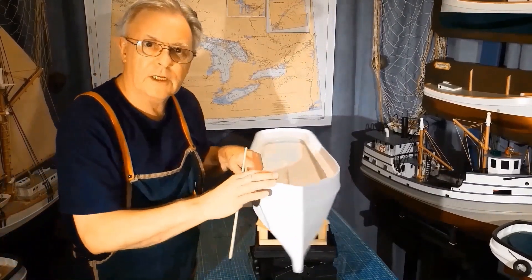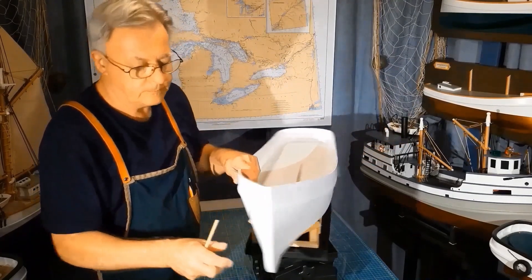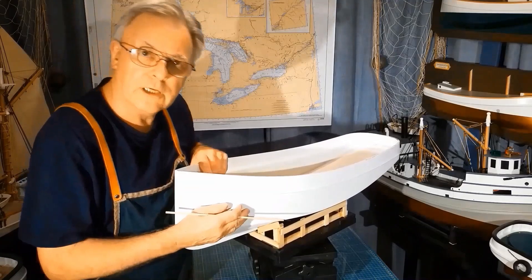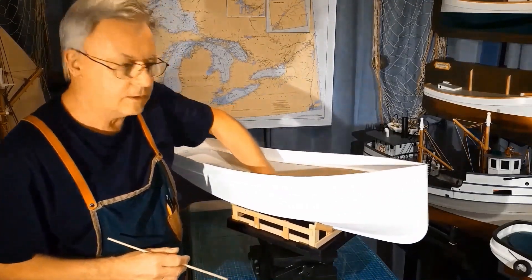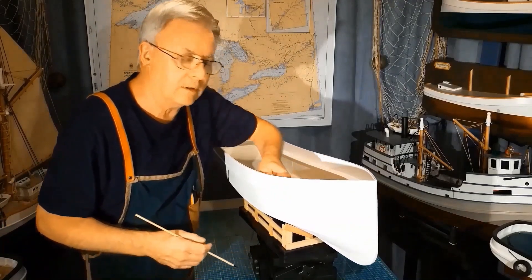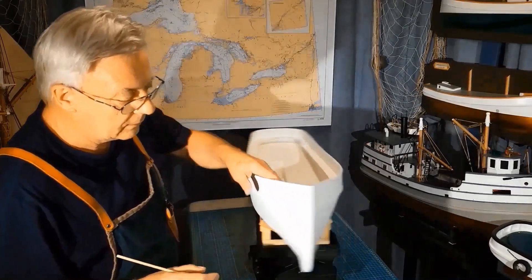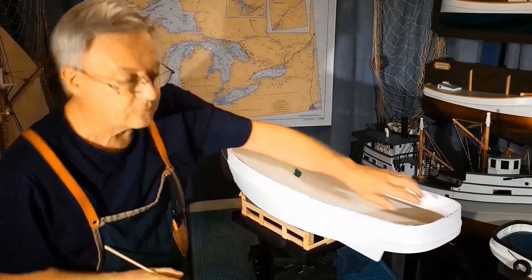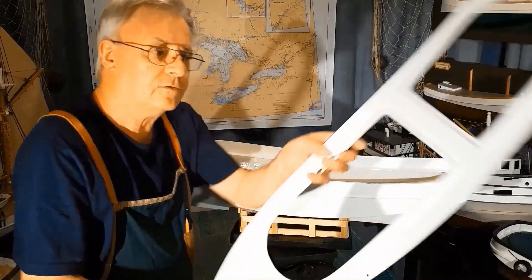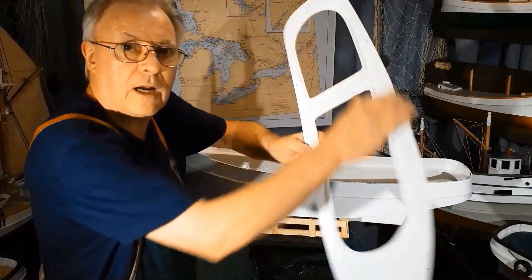We're going to use the fiberglass version of the 34-inch hull used on the other models. I've made a two-part mold. The hull is a coat of gel coat, unwaxed, and two layers of one-ounce mat. There's a layer of gel coat on the interior. The model has a flange to be used as a deck shelf if you were building a model directly onto this hull. There's also a gunnel all the way around the hull that is at the same height as the deck flange. Two layers of one-ounce fiberglass with two hatch openings with a hatch combing around the deck.